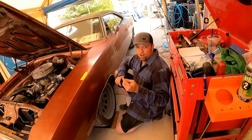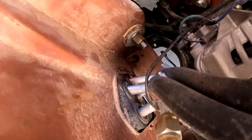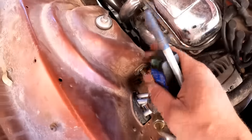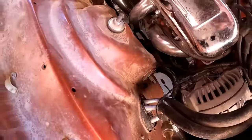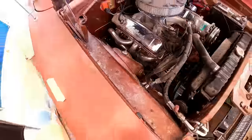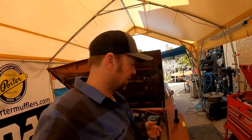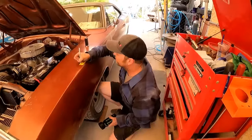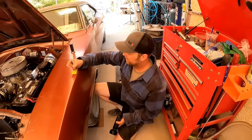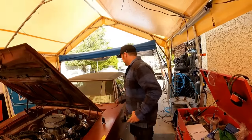And what I like to do to start off with, so your cam bolts right here. Those washers are eccentric. And so if you rotate the bolt, it actually pulls the control arm in and out. And what I do is I set them up neutral, pretty much just bolt up on both sides. So that way it's neutral. And that way, if I need to make an adjustment, I know the control arm is neutral, and so I know which way I need to go to make my adjustment. So now I've got 1 3/4 negative camber. I'm going to write that down. So negative 1.75 is my camber.